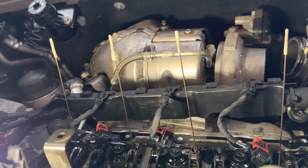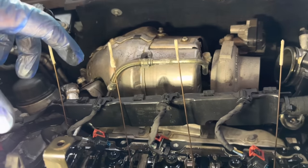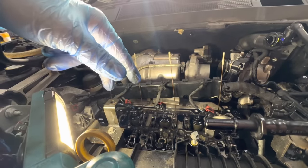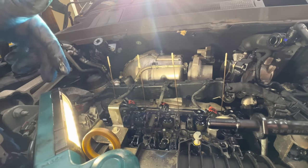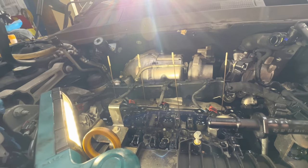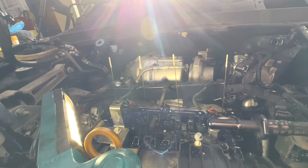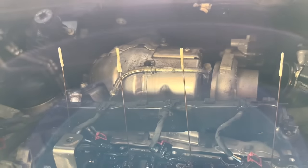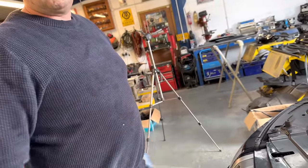And then that way, when we bolt that cam carrier back on, which we're only doing temporary, there will be some valves that are forced open by whatever position the camshaft's in. They won't come into contact with any piston. We've basically got the pistons down out the way. Does that make sense? Yeah, but they're all bang on at the moment. They're all level, yeah. So the crank's in a position where two are halfway down and two are halfway up. Effectively level, halfway in the bores.